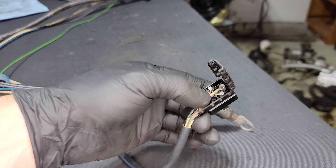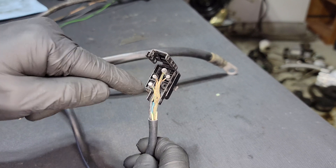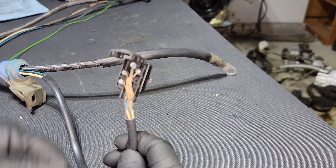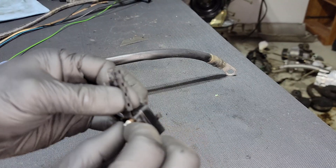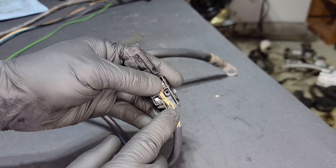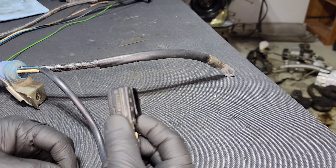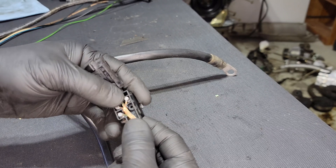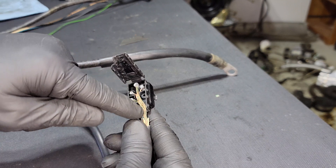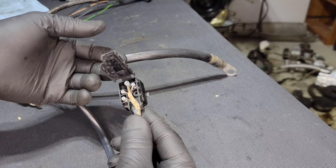Be careful and try not to remove them all at the same time without knowing which wire goes to which pin, because it'll be really difficult trying to get them back in the right spot. Each one of these wires has to come in here and has a little opening where the pin goes in the top. These pins aren't available separate from the harness, and they're not exactly crimped on, so you can't really replace them. Pay attention to the little bit of space you have in here — if you try to throw on a solder connector inside this, you're going to run out of space real quick and you're not going to close this back up properly.